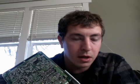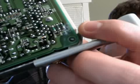And this serves a number of other processes in your car. For me, it was the fuel pump issue. It regulates your idle speed, regulates your spark plugs and fuel injectors, things like that, so it could cause a number of different problems. I inspected this circuit board, and I couldn't really find anything that looked terrible. There was a little bit of weathering. Right down here you can see just a little bit of corrosion, possibly, but I don't know if that's it. Maybe it just went bad. These only go bad for a few reasons.